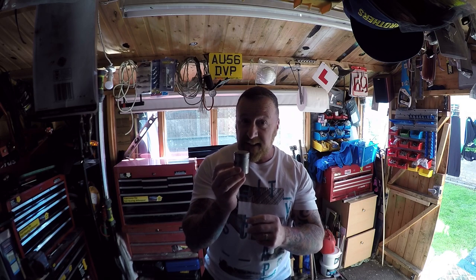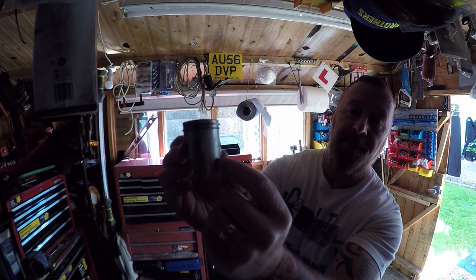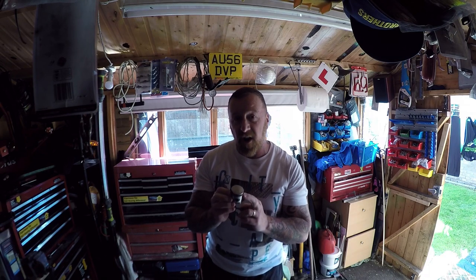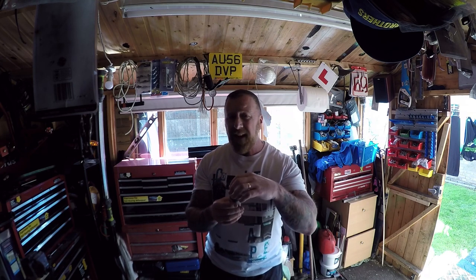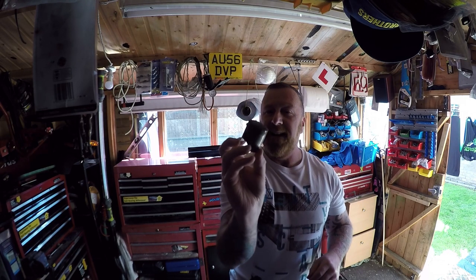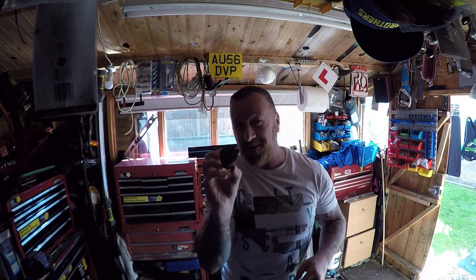This piston was only fitted and did a couple of miles up and down the road, and you can see it's scored. Look at that - heat seized. Now, often you will be able to get the bike started after a heat seize, as long as it's not too major and it hasn't obliterated the piston. This one, as I said, is new. This is what can happen when they explode and go really badly wrong. And as you can see around the sides of this one, you'd know if your piston was like that when you took the head off.